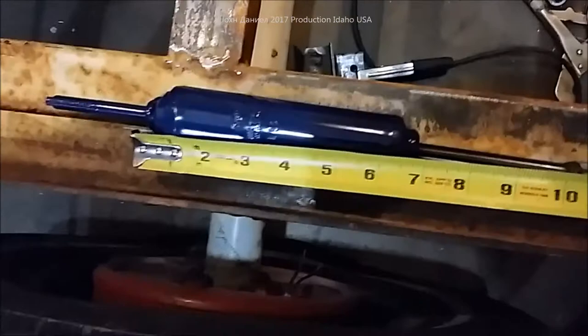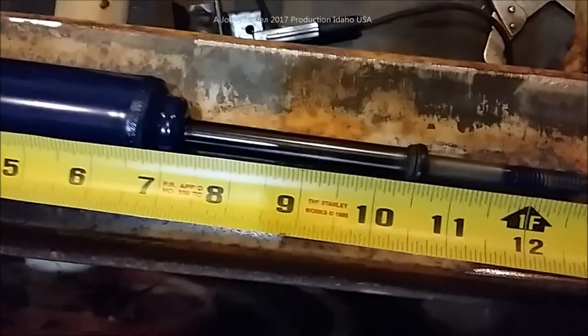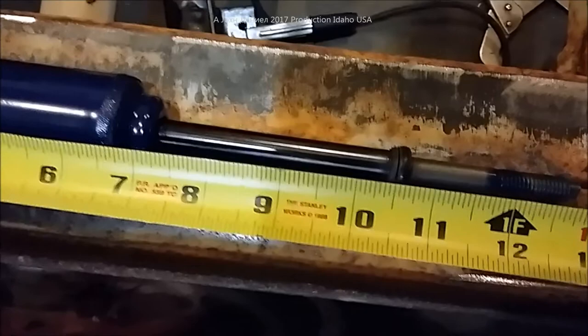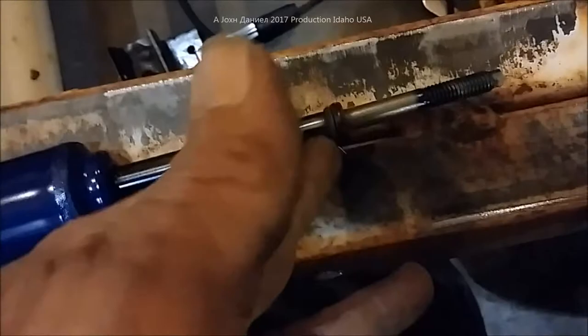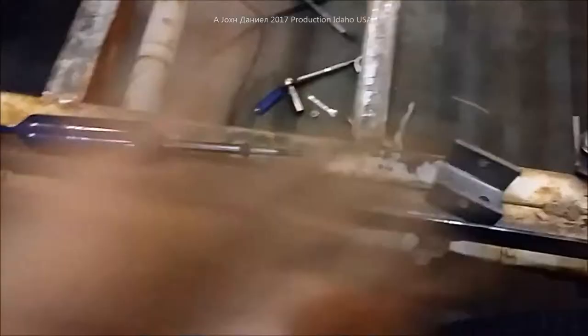The entire compressed length of the shock — minus the rubber isolator pads — is ten and a half inches. I set mine up at about nine and a quarter inches, and then when the rubber pads go on it allows plenty of travel so if the frame lifts it won't jerk and break the shock. This frame is empty right now and will have an additional 500 pounds of wood, side framing, and fenders added, so it'll drop down about another half inch — but it'll still give a lot of shock control.